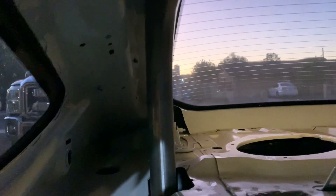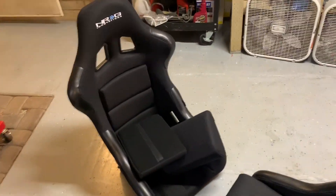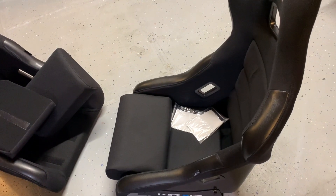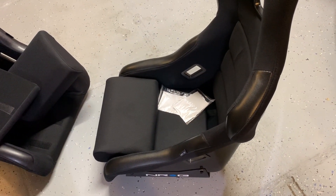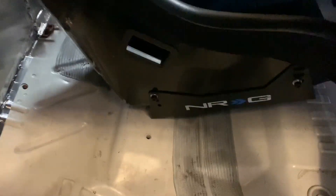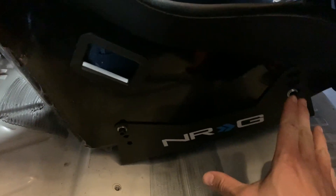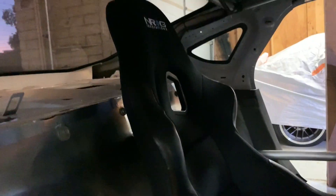I don't want to get into Devin's work because it would be a shame to put my mitts on his beautiful cage work — he tagged the whole thing. It's inch-and-a-half tube; I only have a bender for inch-and-a-quarter. I do have inch-and-a-half material, but I don't have a bender for it, and I want to make the bends kind of go into the base plate. So I'm going to mock this up and show you how it looks. After shoehorning that seat through here, it's not terrible, but I'm going to adjust these brackets to get the seat lower back here. That should set it up a little lower — definitely a small person's seat.